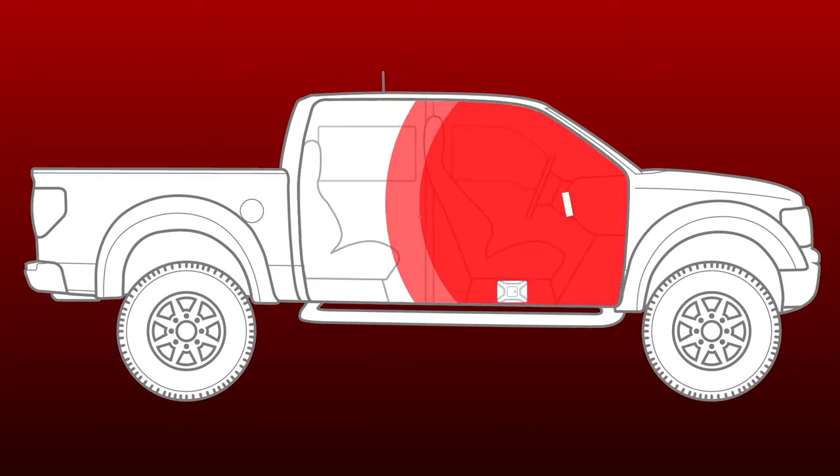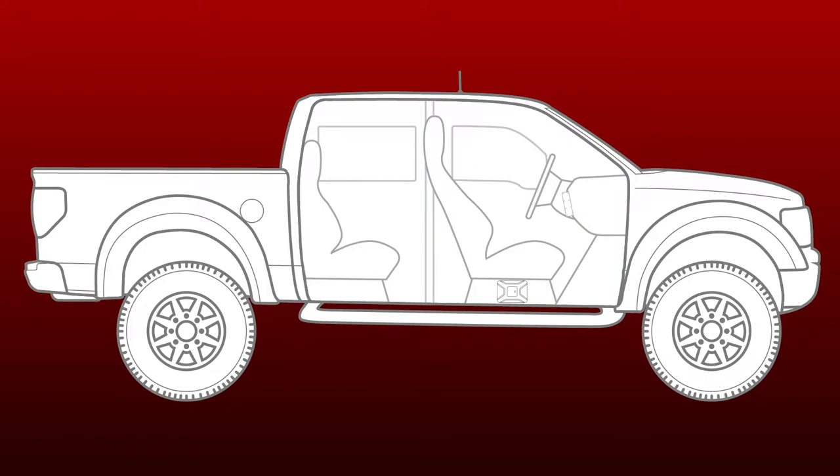Having the antenna too close to a window or sunroof may cause oscillation, resulting in a smaller coverage area inside, or possibly shutting down the booster as a safeguard. Placing the antenna too close to another antenna will also negatively affect the performance of your booster. Antennas or metal objects nearby will shield the booster antenna or create interference with it, resulting in reduced performance.